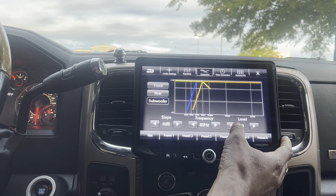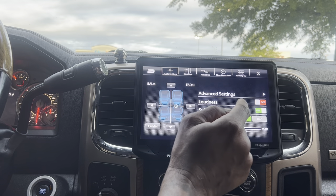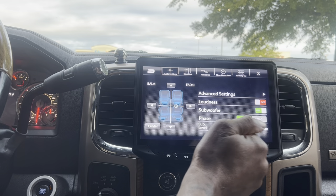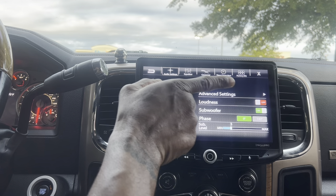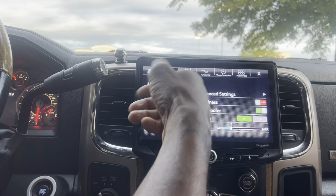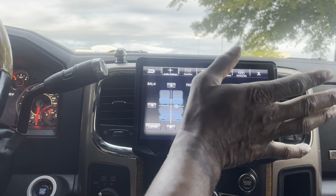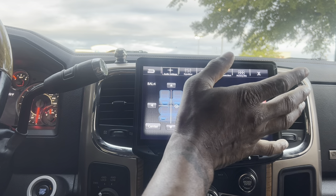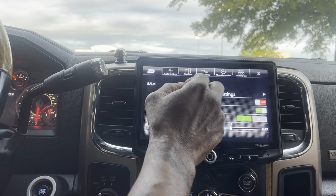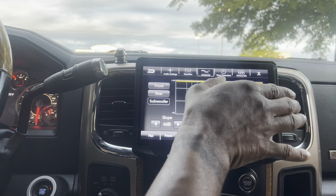I also have a level control, and in concert with my audio control, the sub-level is controlling your RCA output. If you have an RCA output, there's two volts, or maybe four volts. If you have a sub-level control, you're able to gauge what voltage is actually going through the RCA output. By minimizing that voltage, you minimize how much the amplifier amplifies the signal coming in, giving you a certain power output. So if my amplifier is set at, say, 1,000 watts, by minimizing the output signal on the RCA, I can minimize it — and also for my crossover setting, minimize it there as well — so I can lower how much power is actually making it to the sub.